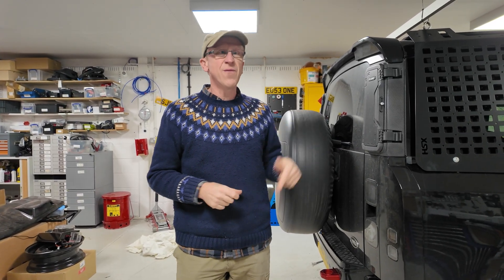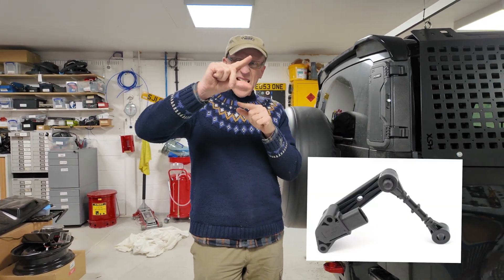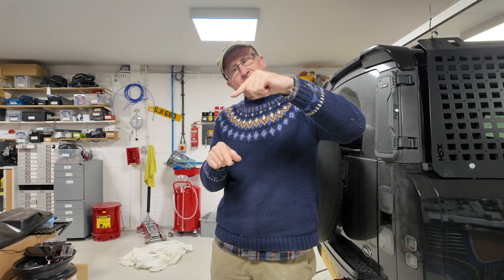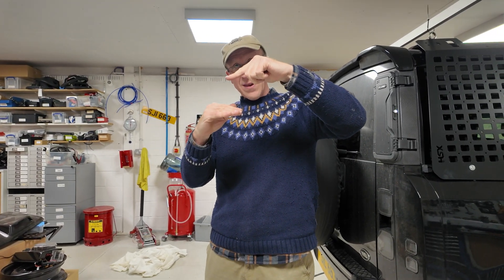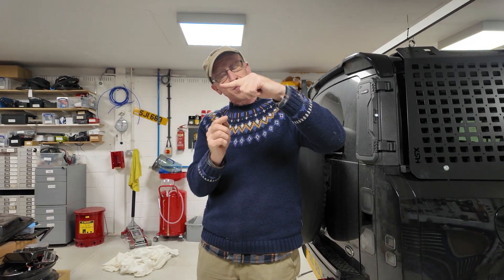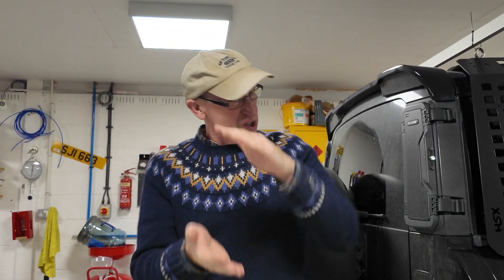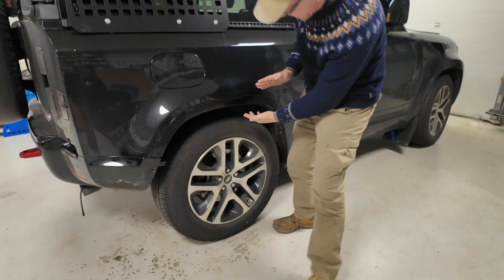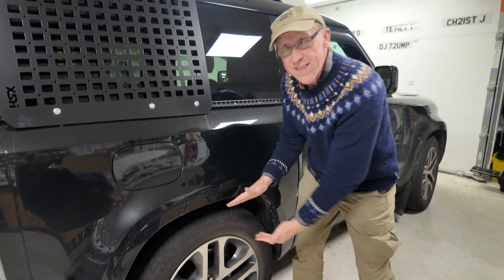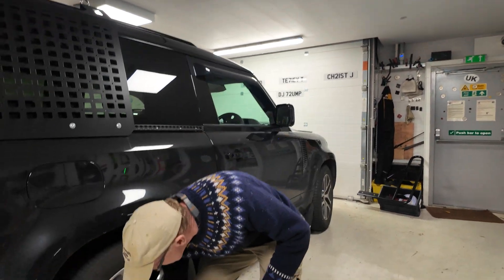It's worth noting that the way the vehicle does the height measurement on these cars is there is a sensor on a little drop arm — a sort of variable resistor — and as your body goes down if you put extra weight in the car, the angle of the sensor changes. But it only goes from the axle to the car body, so it's only measuring the distance between effectively here and here. So lowering the tyres isn't going to affect this distance — the car should not register any change.